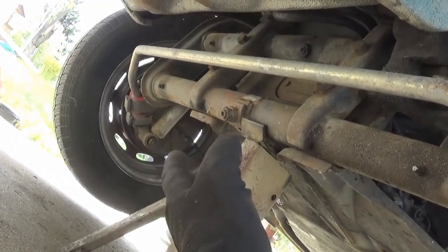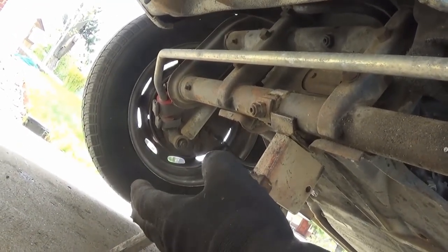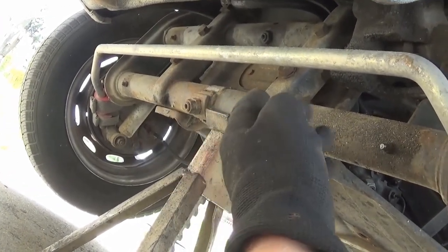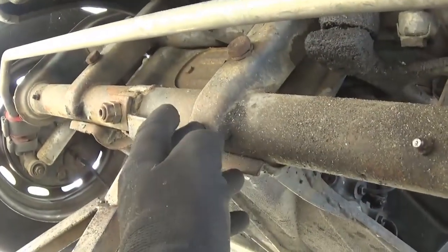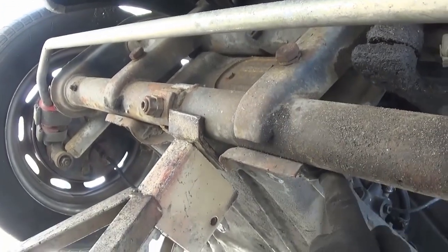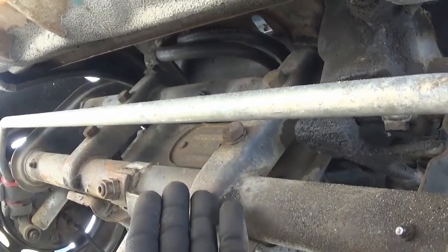So it changes, you know, having a ball joint. There's special ball joints. I don't think this has them, but they articulate a little deeper. When you start changing things, it changes the alignment, it changes the Ackerman effect, it changes the handling. And if you drop the front end and get an angle on it, I have some caster shims that I got from Berg. You can loosen your beam, and you can put them behind this lower. They fit right in there, little aluminum shims to push the lower beam out farther. And I believe you have to get longer bolts when you do that. It's only like 3/8 of an inch, maybe something like that. I don't think it's half, but it's enough where you need longer bolts. You just have a couple threads holding it. And basically this is what's holding the front of your car together.